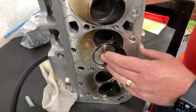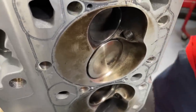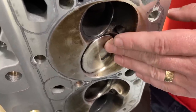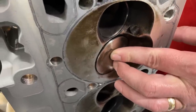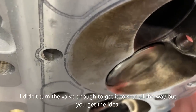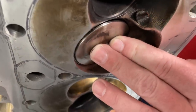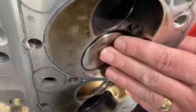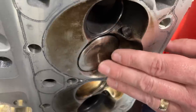This is the head with the bent valve stem. If you look at it I've got the light on the back of it and it's sealed off completely. Now watch what I'm going to do - someone pointed this out and they were a good listener. If I drop this valve right now, like that head balance test you just saw, it would only hit once - it will not bounce. So right now it's sealed up, but if I was to turn that valve and hopefully you'll start seeing it - you'll see this big old gap open like this. This is what most of you see and you're thinking that's why it doesn't seal up. Watch the big old light coming through... and watch me close it off. That's because the valve was bent and then it got straightened.